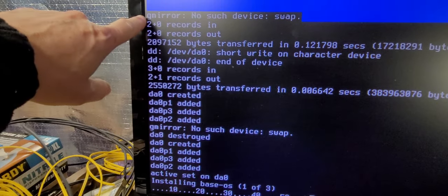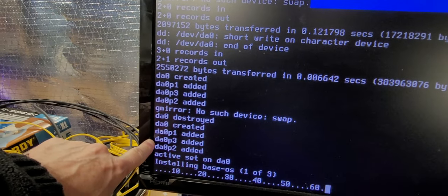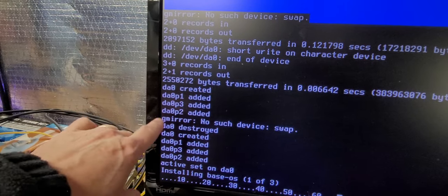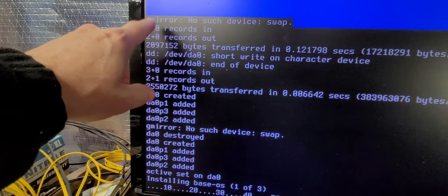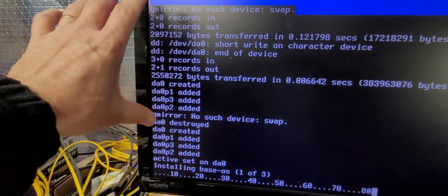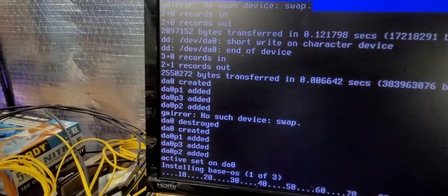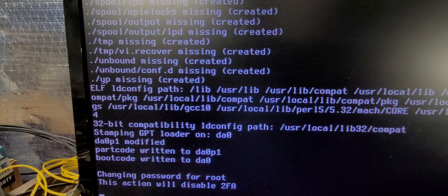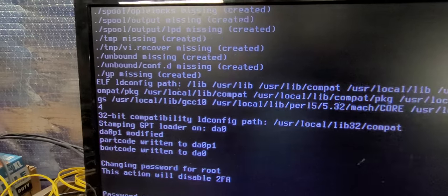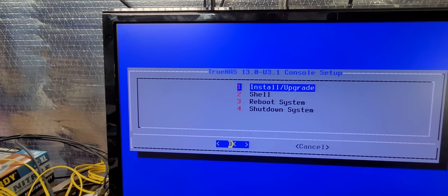Okay, one of the very important details I'm watching as this builds out, you'll notice that my zero set cards, these are my four 100 gig allocation drives, and then my secondary four 100 gig drives are on different cards, and they are identified here. When you set your RAID sets, don't pair them on the same card. Pair this with the other card to give you your redundancy, and pair four of the eight together in a RAID 1 model so that you have functional redundancy. You're not going to be able to do a hot swappable state, unfortunately. The hot swappable is not applicable because this is on an onboard card. So because of that, you need to understand that process.